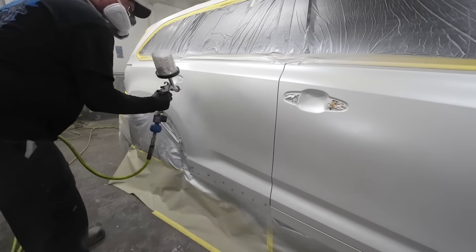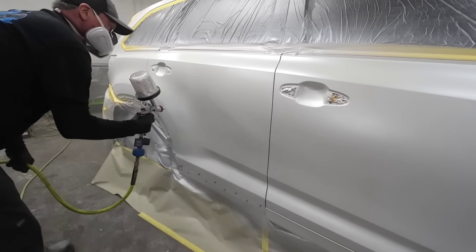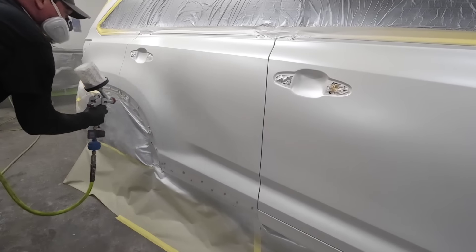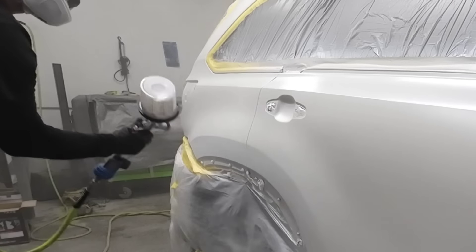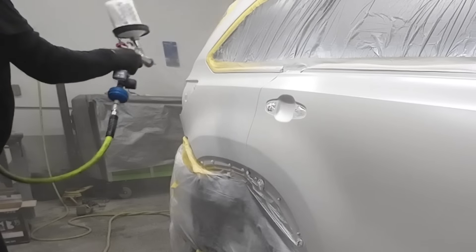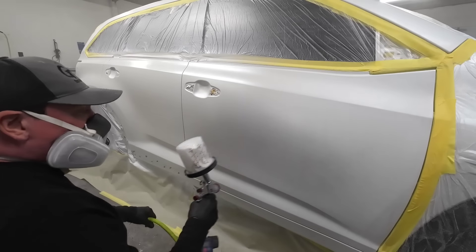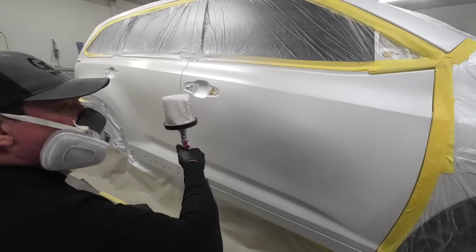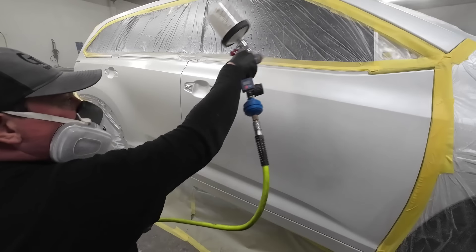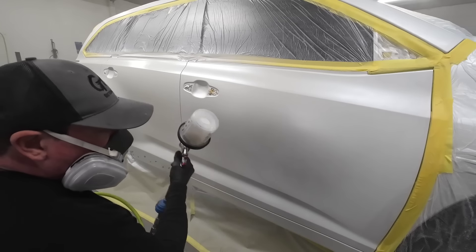You can see there's still very little overspray with this budget R500 paint gun. After the second coat of pearl, all that's left is to blend out the quarter panel and the door just like we did the base white — the only difference is we have to go a little bit farther to make sure the base white is covered with our pearl. This gun lays down pearls and metallics beautifully. I've had no issue with mottling or the way the metallics lay — it comes out nice and silky smooth.